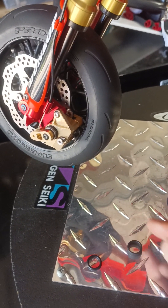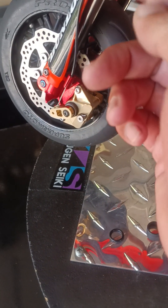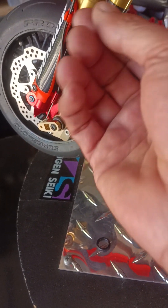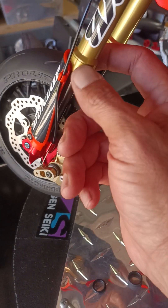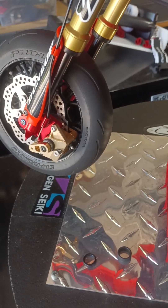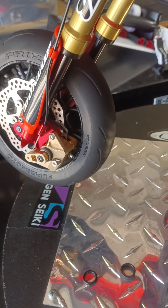So you don't use the original ring anymore — you just put one of these o-rings in there instead. Then go ahead and put your 3-in-1 oil, or your WD-40 and 3-in-1 oil mixed together, on a Q-tip, get it all up in there so it's nicely lubricated. Then go ahead and screw your cap back on so it's locked. Then push your compression up and down on your front fork shock shaft and you'll see that it's going to be a lot smoother and a lot faster.